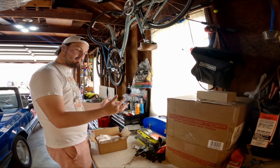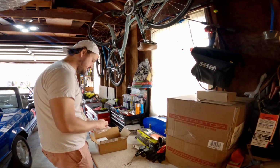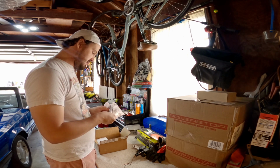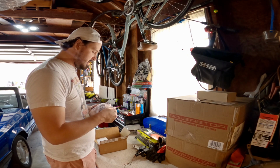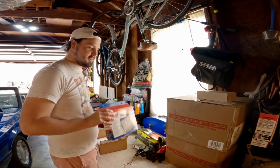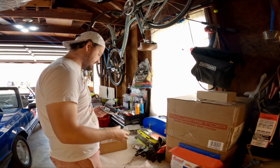So let's go ahead and do a brief unboxing here, what we have and what I ordered, and then we can start getting to work. First thing I see here is one of the most important pieces. If you watched the last video where I confessed my stupidity and realized I really messed up, I said that I need a coil driver and not something like the Summit Racing ignition box. While this is a good piece, it is the wrong piece for this type of ignition setup, and what you need instead is something like this.